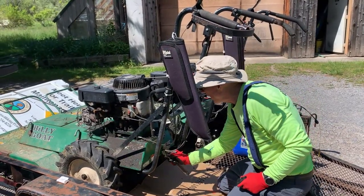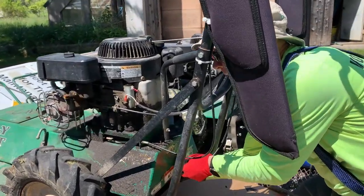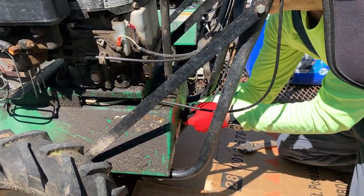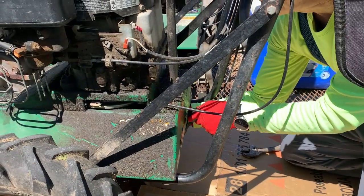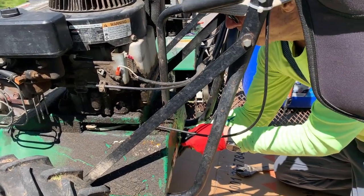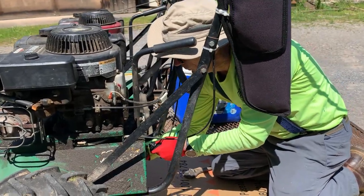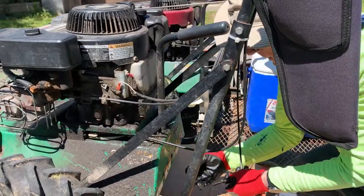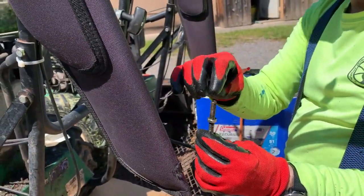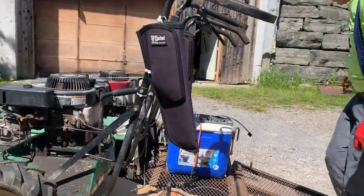Next thing is to get the rest of the cable assembly out of here. We use this side here, then reach under and get the rest of the nut off. If it's worn at all I'm going to have to get a tool in there, but usually I can just get it with my fingers after I've loosened the tension on this side. There's a lot of threads used for adjusting the tension on the cable — that's where it rubs, and that's where it tends to break. So the next thing is to take that zip tie off and remove the rest of the cable so I can put the new one on.